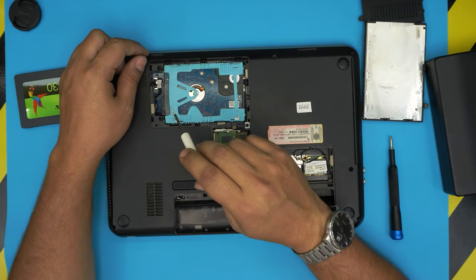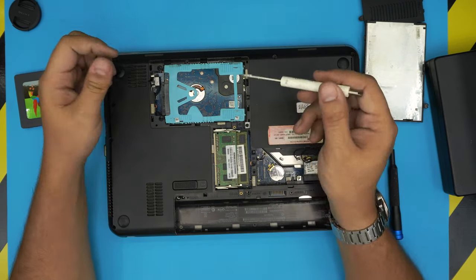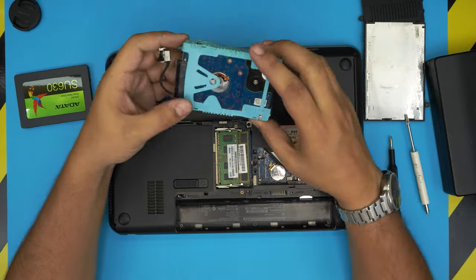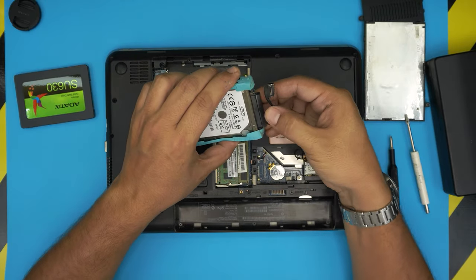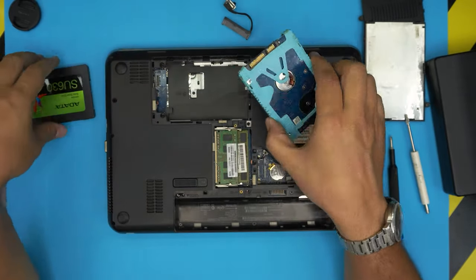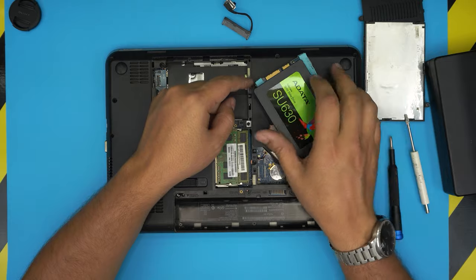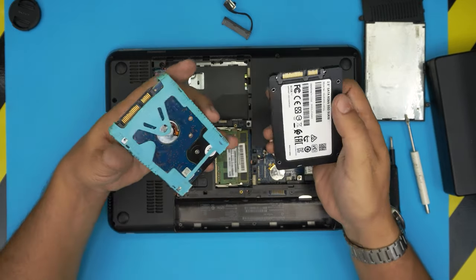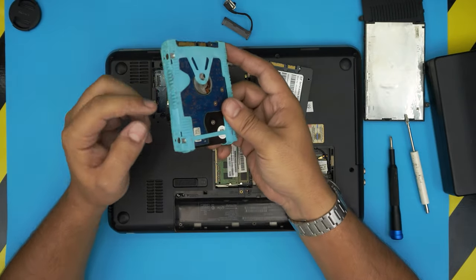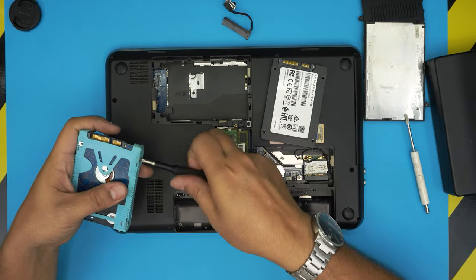Now the hard drive is visible — the caddy is made out of silicone. To remove the hard drive, pull this handle upward, put the screwdriver at the bottom, and lift up the hard drive. Bring it up, then remove the SATA adapter by pulling it — don't pull on the cable, as these are fragile. Observe the orientation of the SATA connector so you don't insert it the wrong way. The caddy is held down by four screws — remove all four and swap the old drive out.